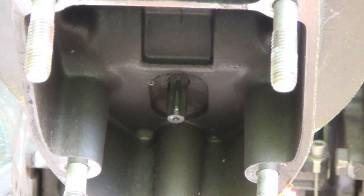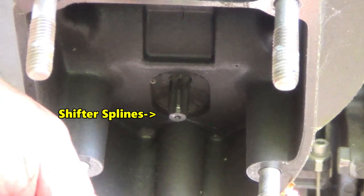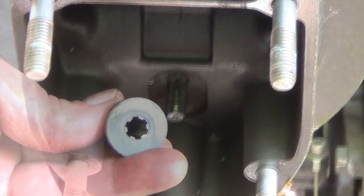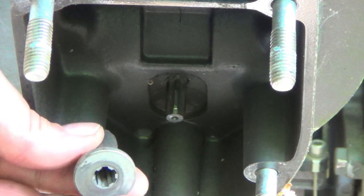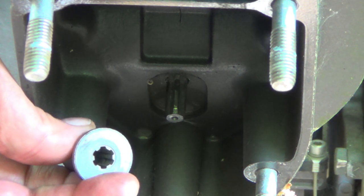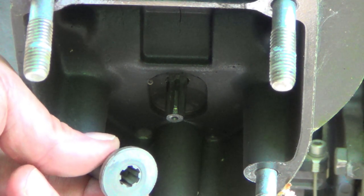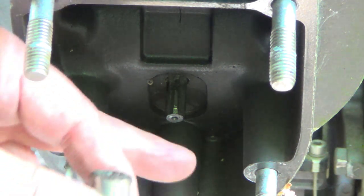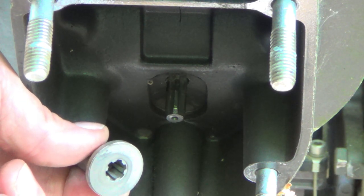You see your shift linkage right there folks. You've got a little splined coupler right here — sometimes it'll stick on there and sometimes it will fall off. The wide side goes down towards the foot. We'll slide this onto the foot before we spline it up in here. It is still in forward so it will kind of hold everything in place.